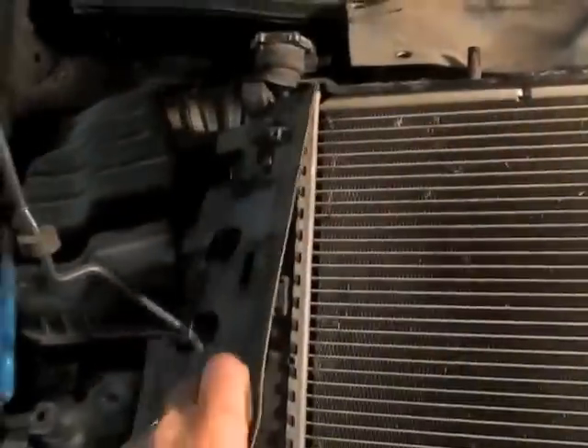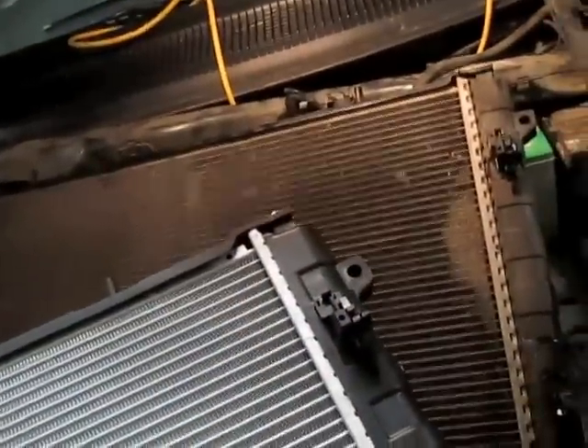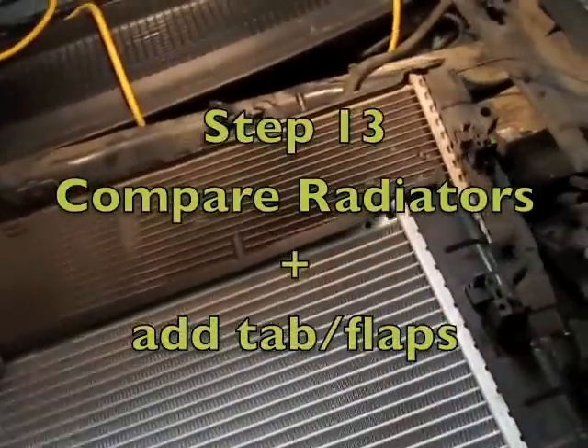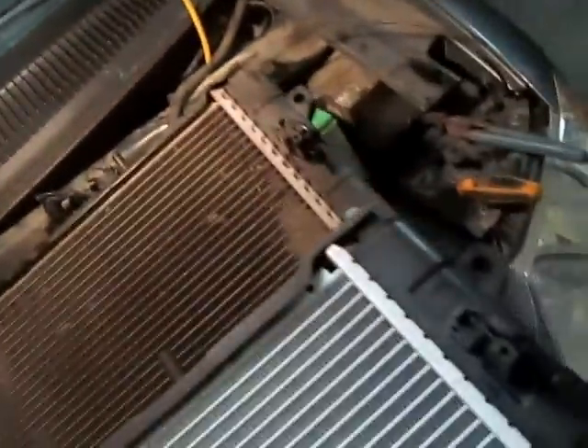Finish draining that. Check to make sure I haven't damaged the AC unit at all. I'm going to need to get these side plates — I have this one here and the one on the other side — and transfer those onto the new radiator. I've removed this one, I'll lay it the same direction so I know where it goes. I'll push down on this tab and pull up. Now I'm going to compare the old and new radiator to make sure they're similar and there are no components I need to detach or attach. They're the same unit and match up identically.